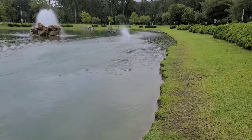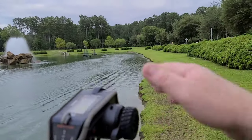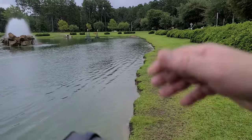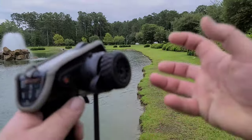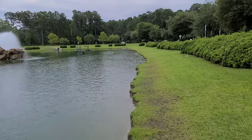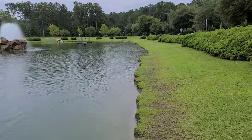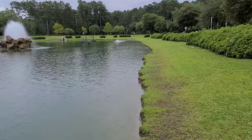It's actually not torquing the boat over so bad. Before I had a lot of prop in the water and it was wanting to torque the boat over — now I've got less prop in the water and it's not grabbing the water so hard and torquing the boat over. Like I said, if you're running a big prop you can run your strut position higher than the ride pads and get a pretty good ride with a big prop.